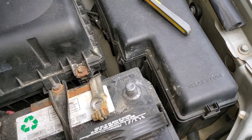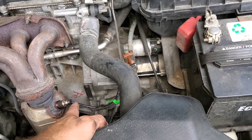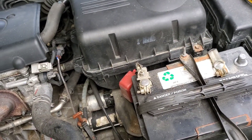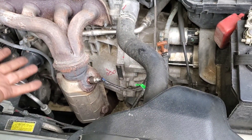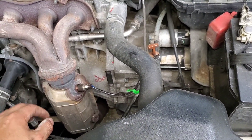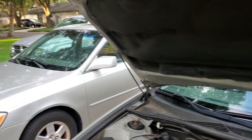I'm just going to reset it. I cleaned it and tightened things down — I want to see what it says after cleaning, how it runs, and whether it stalls. If it stalls, I'm going to disconnect the O2 sensor and see if I can bypass it, which means the computer will just throw fuel at the car to keep it running. Hopefully it won't keep stalling. To replace all of this would be a ridiculous amount of money, so I'm not sure how far you'd want to go with it all.